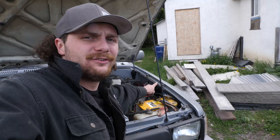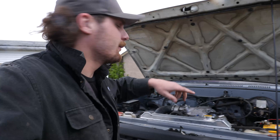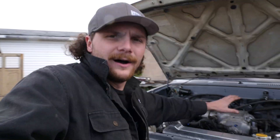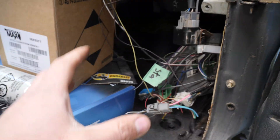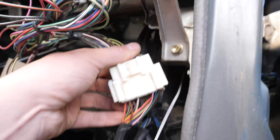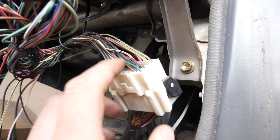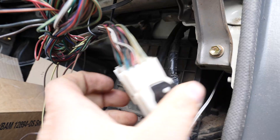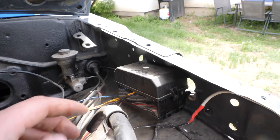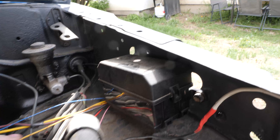What I used to distribute all of these power sources is an extra fuse box added to my engine bay. This fuse box is entirely responsible for giving power to the injectors, the igniters, the coils, and so on. I used three of the fuse positions and have four relays installed — pretty much everything that requires switched power is given power by these relays. The ECM main BAT wire also comes through this fuse box with its own fuse, but no relay. Moving into Corey's truck, which has the 2RZ swap, this right here is that 1K2 body plug. You can see the white wire with the red tracer powering all the sensors, and on the back side a black wire with a red tracer powering the coils and injectors. Corey picked up the exact same fuse box I'm using, and these are the four wires — that's all that was required to get the 2RZ running.